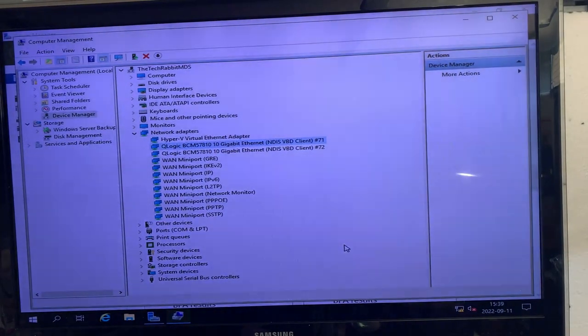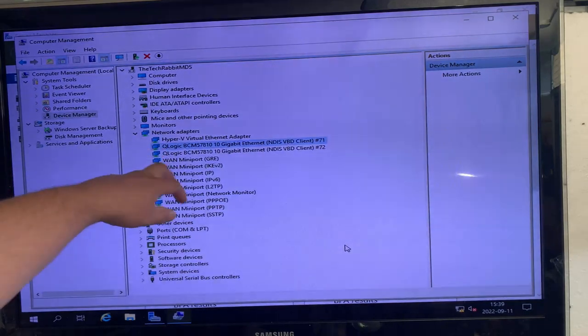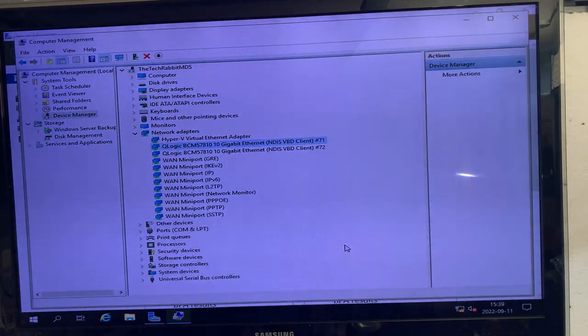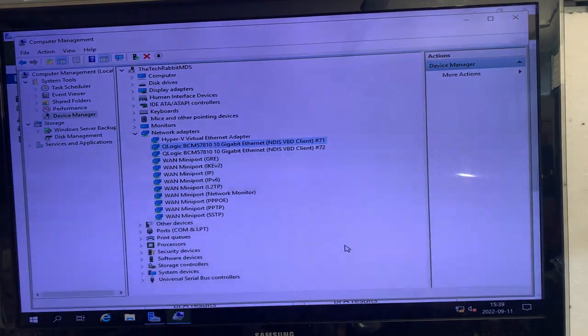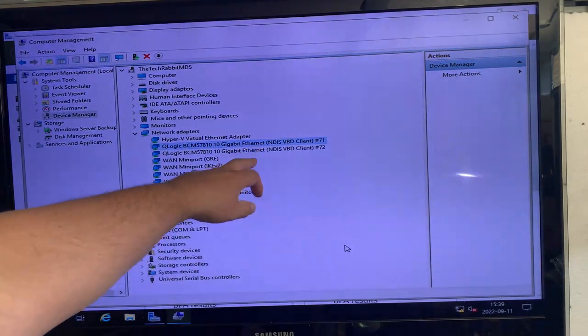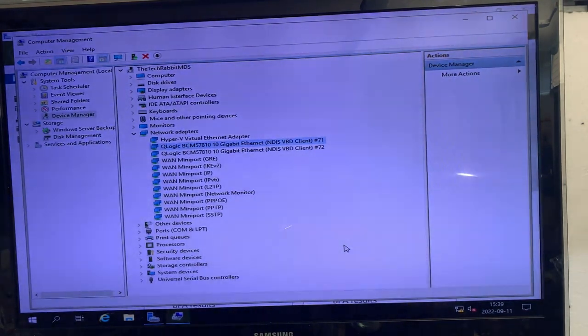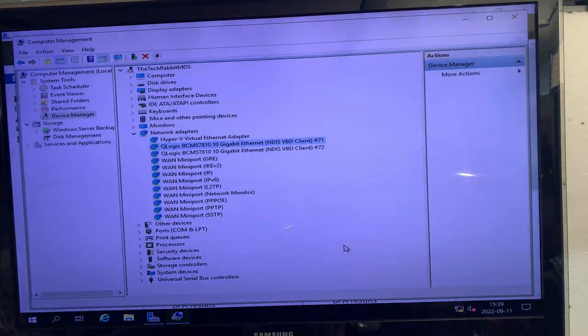Oh, it looks like this is on Windows Server. And as we see, this is the device manager, and it says that we have two 10 gigabit ports. Now, in the device manager, it's not showing what physical media adapter you have, or whether the physical media adapter is active or not. But it actually showed it in the boot sequence of the BIOS and the initialization there. So I think I'm going to rerun the boot and capture that.